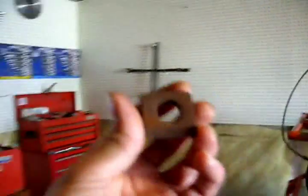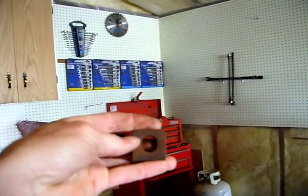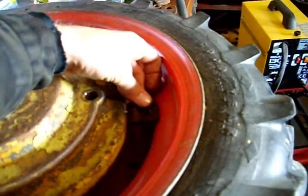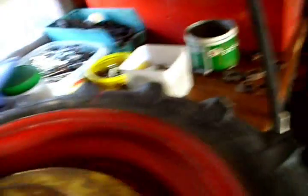What I've got here are adapters for five-ton float rims, where it's just the ring attached to the big hub on a five-ton float. So what I'm gonna do is put them right here to hold down onto the rim, put four all the way around, center it, get them welded in. And then I'll be able to connect them to my four holes.